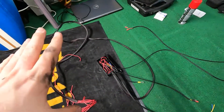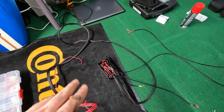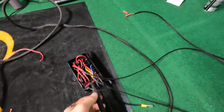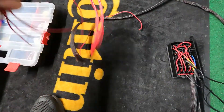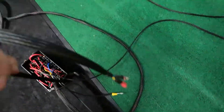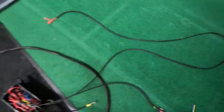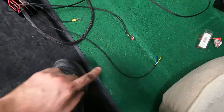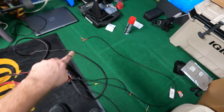I'm going to plug in the rest of the wires and we're going to go to the switch panel. Once this is all situated, I'll put heat shrink on this one too. So the relay box is pretty much wired up how it's going to be for the time being, until I decide what else I want to do with those other relays. We got the main harness going to the switches coming out in these wires, so we need to wire that into the switch panel. Then we have the two wires that go to the MAF sensor and the two wires that go to the boost controller, but I'm not going to do those quite yet. This wire right here routes up to the LED strip.